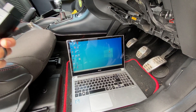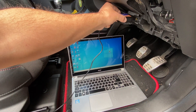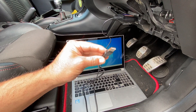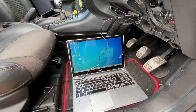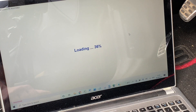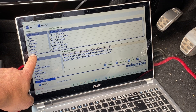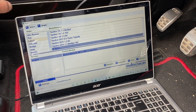For connecting the laptop to the car, we're going to start with just basically having the adapter ready, which we're just going to plug in to the port on the car. It only goes in one way — there's a small lug at the top with a little lip. Then the other end is a USB connection so I'm just going to plug that into the laptop and open up the software. With this particular software you can see we've got a selection of different manufacturers to connect to, and once you select a manufacturer you get the different vehicles in that range.